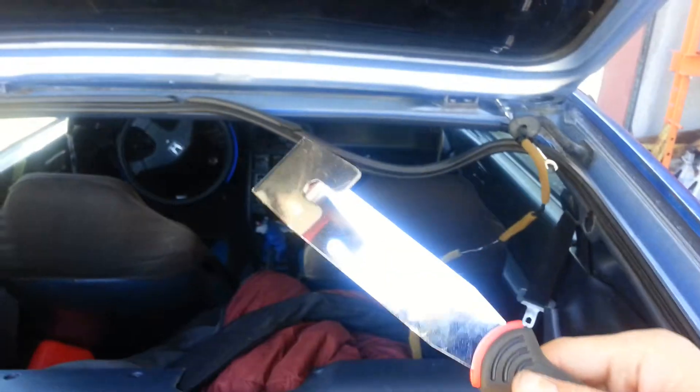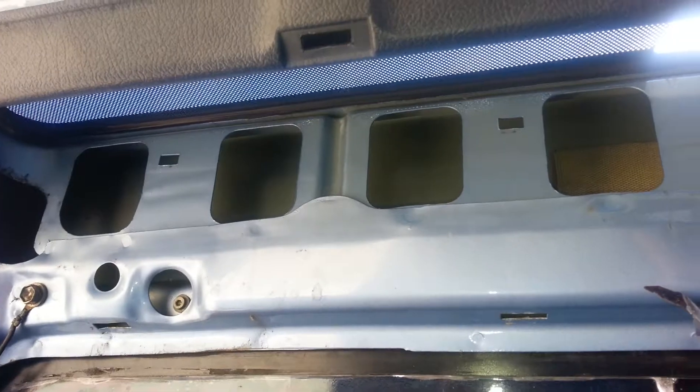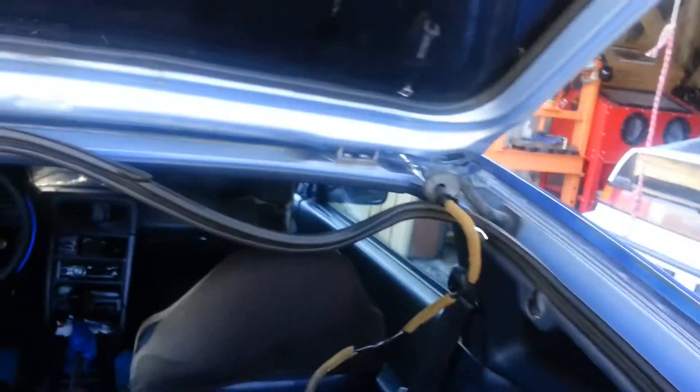You've got to get over here on this end. I used this tool from Harbor Freight, got up underneath there, and you have to pop it pretty good. I like to do quick bursts of movement — there's less chance of the molding breaking. Going nice and slow tends to find the weak point of the molding and snap it, so quick bursts work well for this.